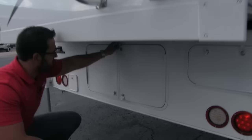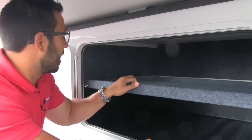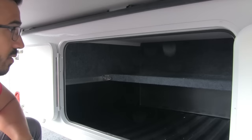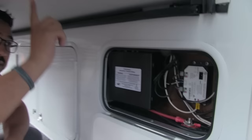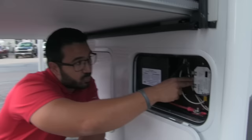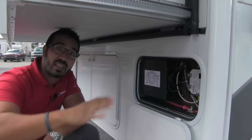LED lights on the back here as well. Underneath, let's open this up and take a look at this extra storage — it's really cool back here. This will be a little easier to access when the unit is higher, but this is a removable shelf. You can take it out or slide it back and forth and lock it into place — a very large storage area for a truck camper. Moving over a bit, right here is your transfer relay, which is actually the slide control. The cool thing is if your slide ever fails, you just pull these two plugs and manually push the slide in, then reattach them — they're essentially the brakes for the slide — so you'll never get stuck somewhere.